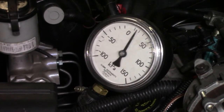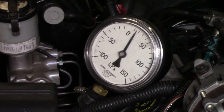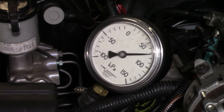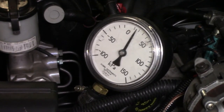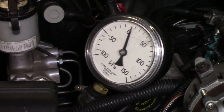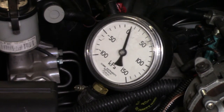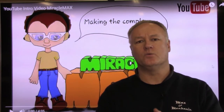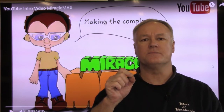At about 2000 to 2500 RPM, we should be getting roughly 70 KPA to 100 KPA. That 70 to 100 KPA is roughly about 10 to 15 PSI, which is right on the money. So according to this test, this particular water pump is flowing the coolant correctly. Simple test, hey? Just by carrying out this simple test, we can ensure that the water pump can circulate the coolant enough to make the cooling system efficient.